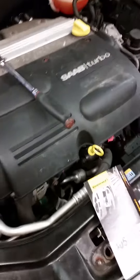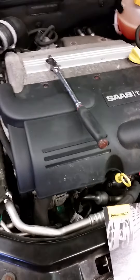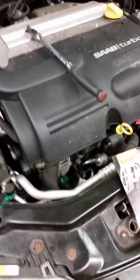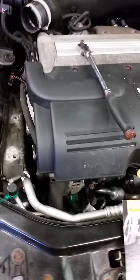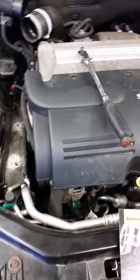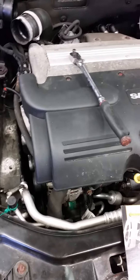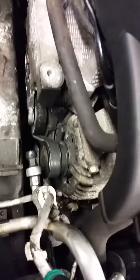Definitely don't have to do that. So what we did today was we had a bad clutch on an AC compressor. Now this person, they don't have a ton of money. They have a nice car, but they're not very wealthy. So what I did was I measured the pulleys, and it's between 35 to 36 inches without the AC compressor. So you can probably get a 35 and a half inch belt, and it worked absolutely marvelously.